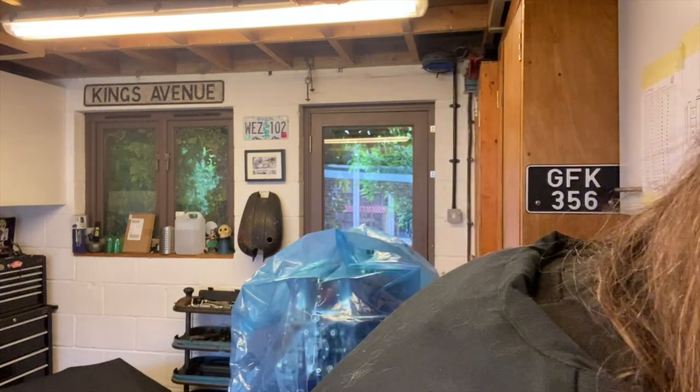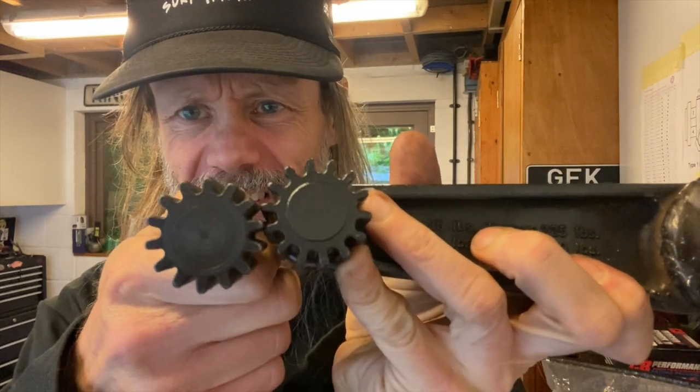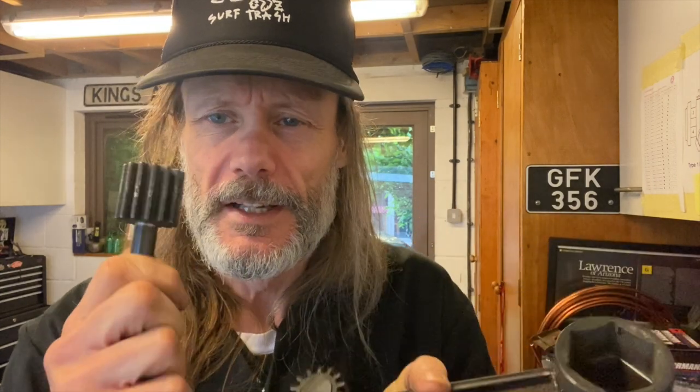Super happy. It turns out when I torqued it down I used the old gear which came with the old tool, and that's been the problem all along. If we look at the teeth, these teeth on the old gear are slightly fatter and a different profile — slightly flared at the base — and that's why they were slipping, just not bedding in enough. So it wasn't me all these years; I actually just had a dodgy tool. Bad workman blames his tools, right? But now I've got a new tool and it works brilliantly, and I'll put this new 38mm one with my 36mm one so I have a Torquemeister for every flywheel I'll ever need to do. Thanks for watching.